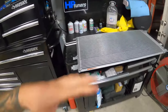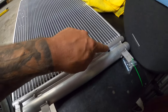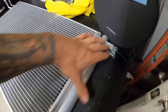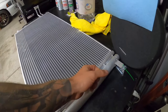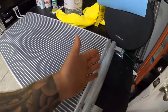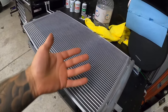This is a common issue, and this is the new condenser — this one is actually reinforced over the factory original. The original one only has like three tack welds: one here, one here, and then one at the top. The way it's supported is from the tabs, so with only three tack welds holding this whole condenser on the whole truck, over time you hit some bumps on the road and eventually those loosen up and the stress is too much and you develop a leak. It's a huge fault on these things — a lot of the vehicles are recalled or it was under warranty, but if you're out of warranty then you're stuck doing something like this.